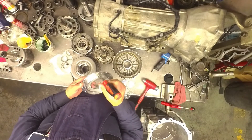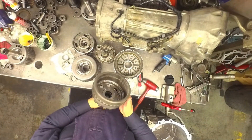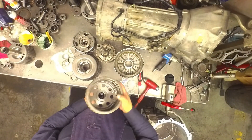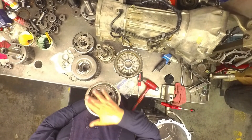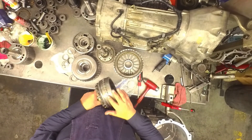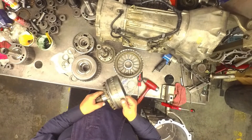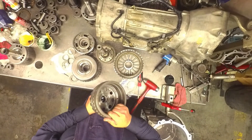This piston likes to crack right down in here — sometimes it's very, very hard to see. This is the late-style planet where it's all one piece. The earlier ones have a ring gear that you can take off. This is a different height — you can swap this out. This is the stouter one; it's actually an update.